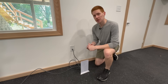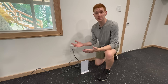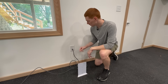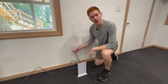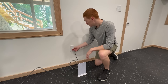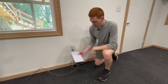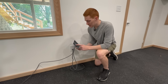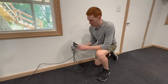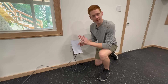The first thing you want to do to fix this 'unplugged or rebooting' error message is simply restart your system. Head over to your Starlink router, unplug the power cord, wait about 30 seconds, and then plug it back in. Give your Starlink unit about 15 minutes to fully boot up. While you're at the router, check to make sure you have the power LED on — on the Gen 2 router it's on the bottom, and on the Gen 3 router it's on the front left corner when facing the router.